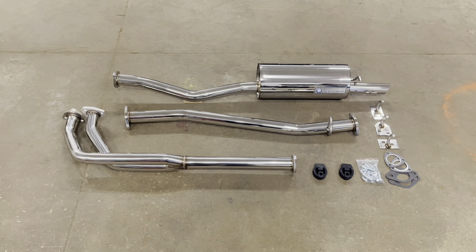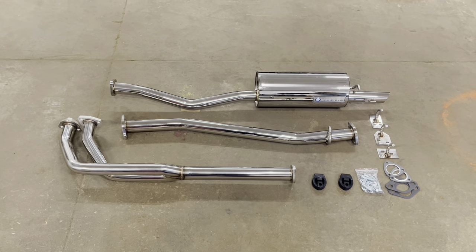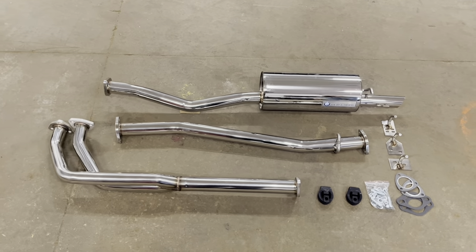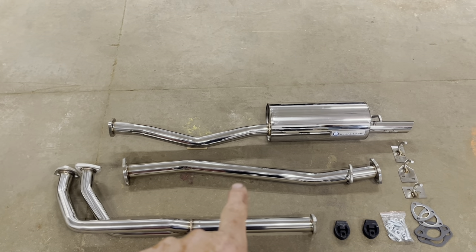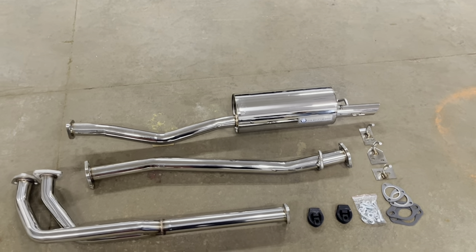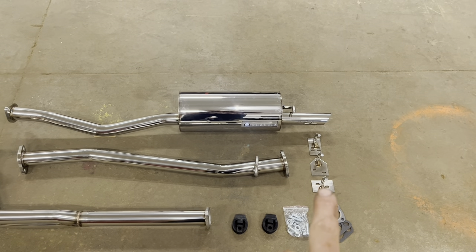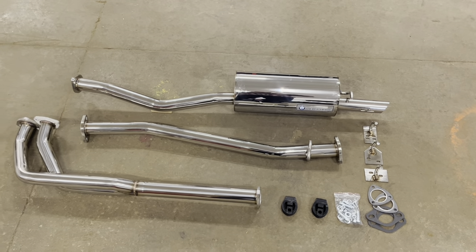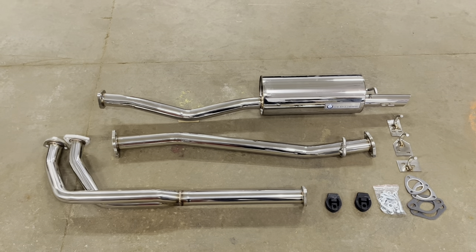Since he loves his car and has no plans of getting rid of it any time soon, he opted to do a stainless steel system. This is the Taurus Trophy from Moss. It comes with the front pipe, mid-pipe without a resonator, and then a rear pipe and muffler. It comes with gaskets, hardware, and all-new modern-style rubber hangers. I've installed a number of these over the years and recommended this would be a good one for him, giving him the tone he would be happy with.